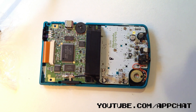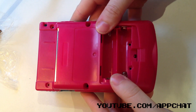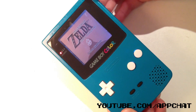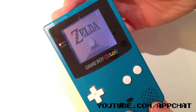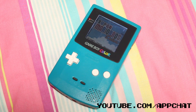So now you've learnt how to do the front light mod for the Game Boy Color. Just screw the three screws back into the circuit board, put on the Game Boy housing and push it together — it will be a bit of a tight fit but it should work. Screw those last six screws on, cross your fingers, turn your Game Boy on, and hope that screen lights up. This is the first video tutorial of this mod online. I'll put links in the description to the other tutorials available — the original by Mike J Moffat and another by ChooChooBot.com. If you have modding or soldering skills and see someone asking for help in the comments, please give them a hand.